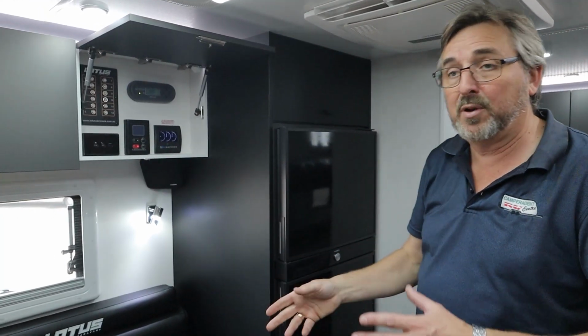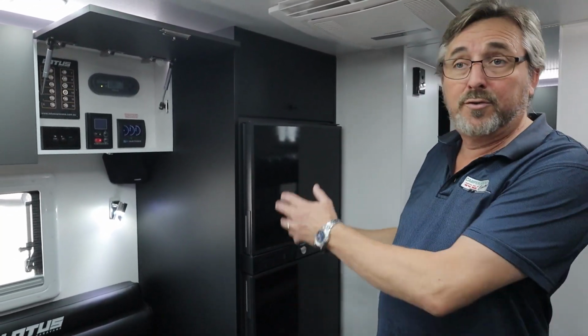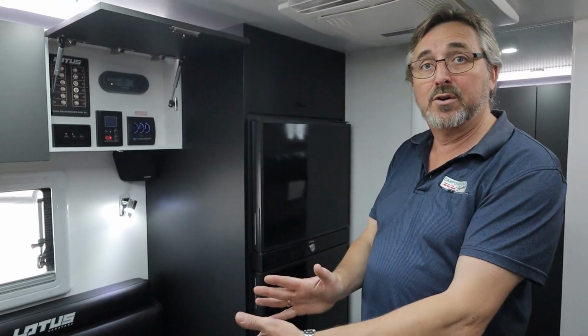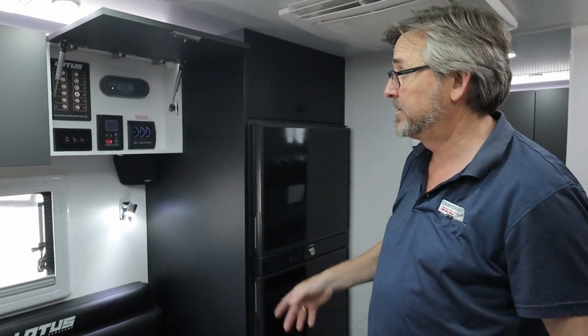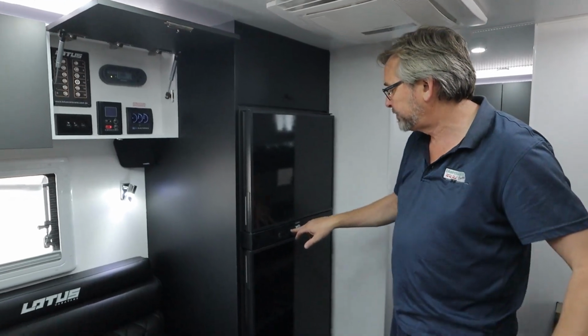If I've got it stored up and I've got that off, but I've plugged in so I can use the fridge, if I lost 240 volt power, my fridge will turn off. If I've got that on, it'll switch to battery automatically, which may drain your batteries down because it's not getting a power supply from anywhere. So have a bit of a play with that, and hopefully that explains it nicely for you.